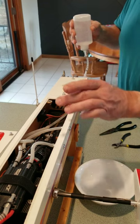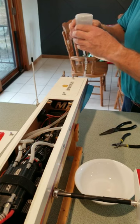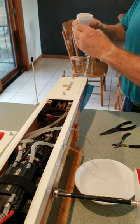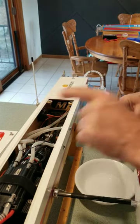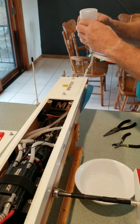What you usually find is there's less restriction in the ESC versus the motor. This front outlet is ESC. You can see by this flow more is coming out, so I'll restrict the coolant line going to the ESC with a zip tie, but I'll calibrate it by again checking the flow.